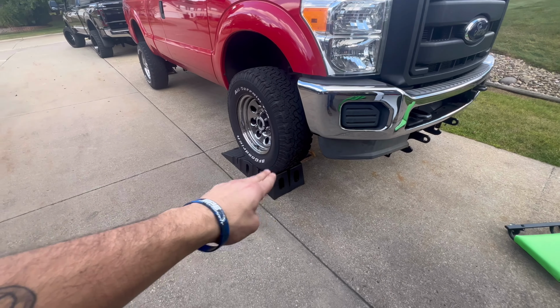So no washers for the front. It's gonna be a 6mm Allen. We're gonna show you applying a bead all around here. We wanna go all on the inside, all around, like where my finger's going, just like this. We're gonna apply that and then it'll smush it down. And then yeah, we'll slap this bad boy on. Try not to smear it. We'll film that on a time lapse as well.